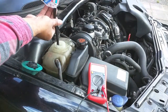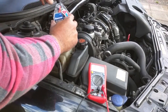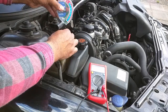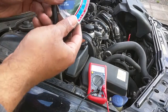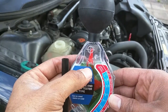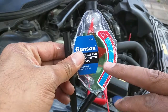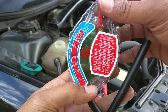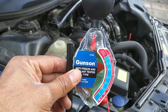I'm going to take a sample by pressing the ball in, getting it nice and low inside the coolant, and letting it go. Make sure you've got enough in there. There's a fill level indicator just by my thumb — you've got to make sure you've got that much coolant in there and there's a little arrow which will confirm there is enough. Having a good look at the coolant, it looks pretty clean to me, free of any debris, no little flakes of rust or anything knocking around in there. So that's a good sign.